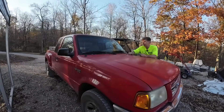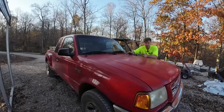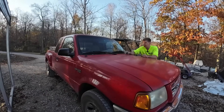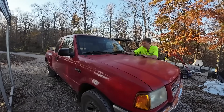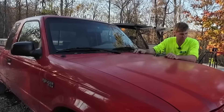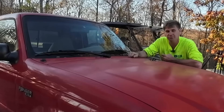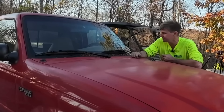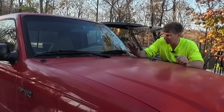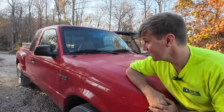I'll put about 120 miles on it to give it a test out. So far it seems to be okay. Still, one time intermittently it decided to idle at 1,500 to 1,600 while I was sitting in the drive-thru. But other than that it's been sitting down around 900 to 1,000, which seems about right. Let me know if you work on Ford Rangers. After looking this thing over and driving it a little bit, I'm pretty sure y'all are going to need to buckle up for the saga of the Ford Ranger. This will keep the miles off that three-quarter ton truck and save me quite a bit in gas — I tested around 19 miles per gallon, which is pretty much double what the GMC got. It's not the best on the market, but for a beater with a heater, I think she'll do the trick.